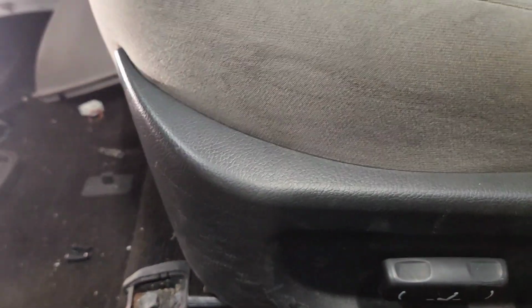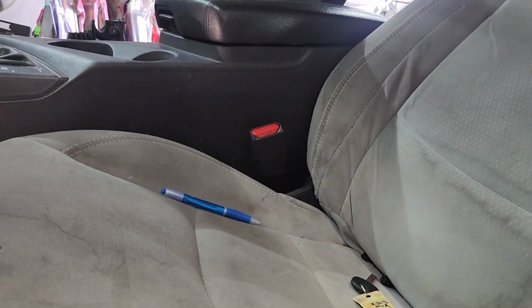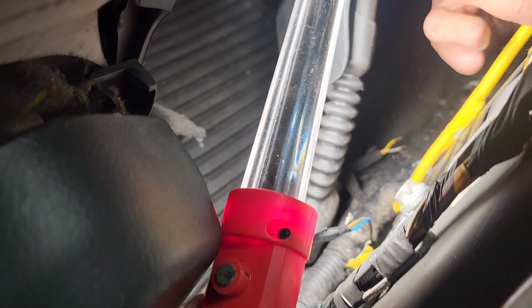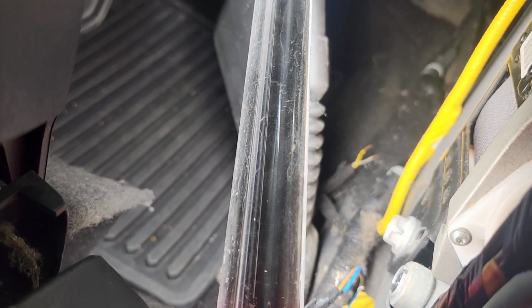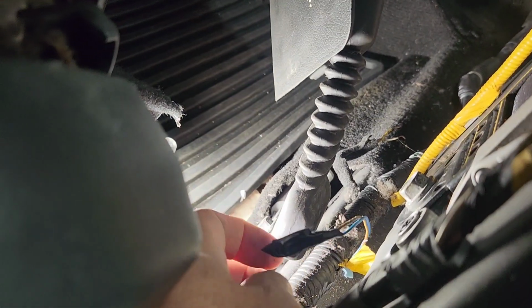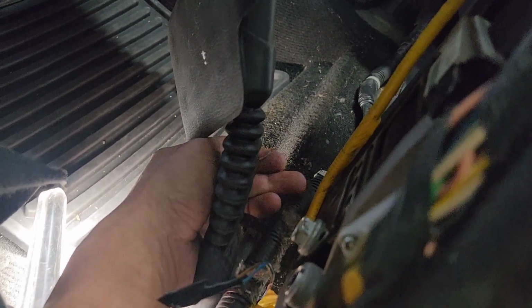So I'm gonna run the blue remote wire all the way to the back, and then tap it, and then I'm gonna cut the one end, so if there's a short from here to here or something, it's not gonna affect much on my wiring. Now when I took it out, there's a couple wires that are open, but I don't think it's related to that, but I'm not 100% sure what the previous tech was doing. They taped this up. I'm gonna just tape this thing up. I'm not gonna touch any one of these.